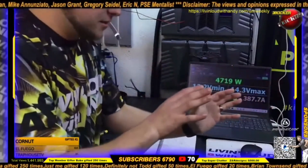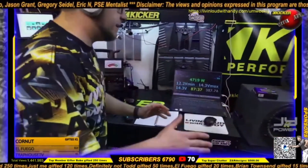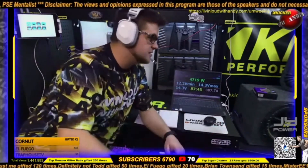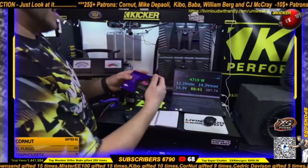Which one is best? Should I just upgrade this or upgrade that? Honestly, it's best to do both — because once you go past what that alternator can do, you're in the same boat you were before you upgraded. So you do want to have some kind of battery there to help take the initial brunt — especially with 2000-watt amplifiers.